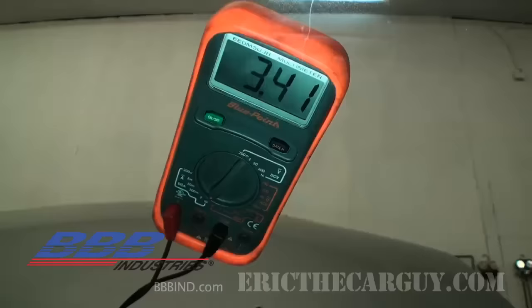Check this out — this interior light switch has been left on. Let's verify that this will get rid of our amp draw and get it down to an acceptable level. We turn that switch off and sure enough, our amp draw goes down to an acceptable level.